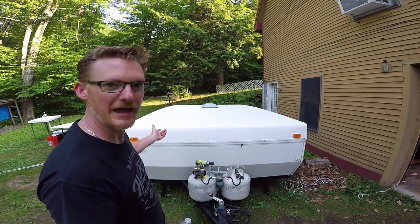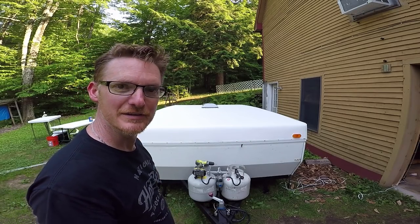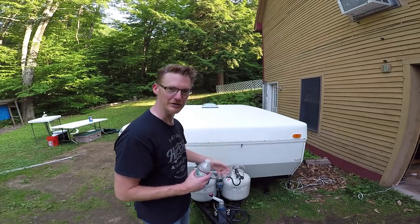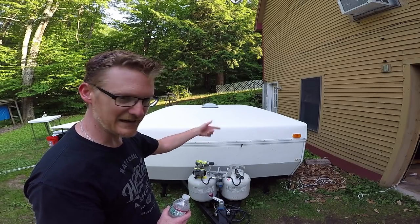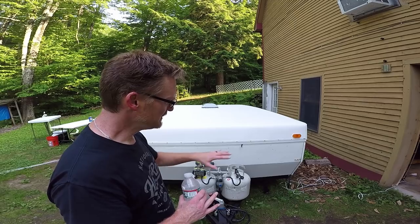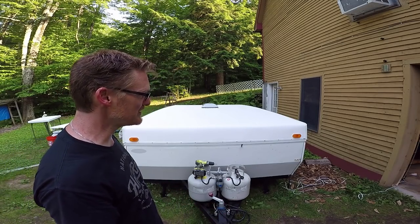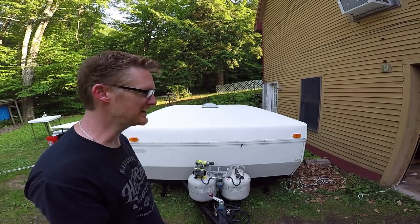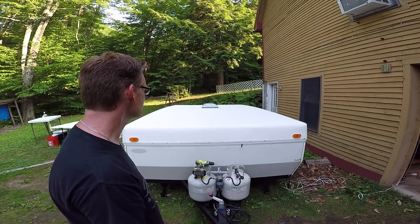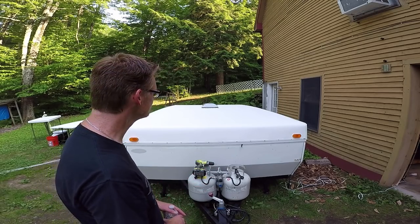We did three coats of the Henry's Elastomeric rubberized paint and it looks fantastic. Lights are back on, tape is pulled off, and after three coats it's sealed and looks wonderful. I'm happy that this color doesn't seem to be too much of a contrast to the sides — otherwise I'd be very tempted to start painting the bottom as well. But the bottom is another story — you wouldn't want to use this kind of paint there. It's too porous and rough; you'd need something more like primer and almost like an auto paint. I think this is a project that's more time consuming than it is difficult — it's more patience than difficulty. Just let it dry, hopefully on a clear dry day, and coat your old pop-up camper top with some elastomeric paint. I think you'll be happy with it. Thanks for watching.